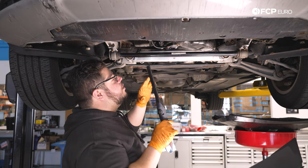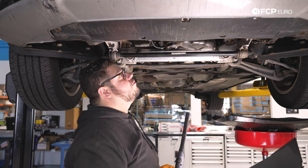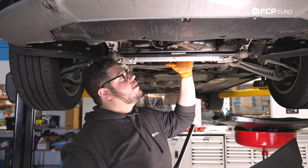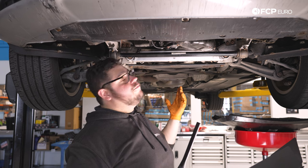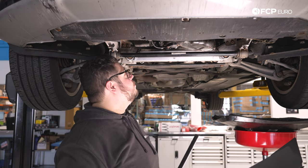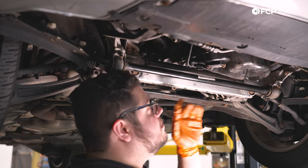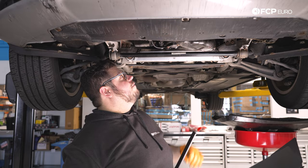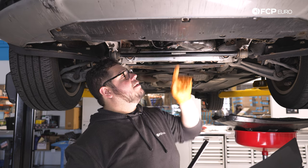We're going to avoid removing any of these items just because we're equipped with a mechanical rack and we're able to squeeze in our tools without removing them. Another tip: if you're lacking the space to work and maybe keeping the rack in place, you can also lift the engine from up top using the anchor point — we'll show you how that looks. We still have the oil level sensor in place merely to avoid drippage while we're removing the T30s. Without further ado, we're going to tackle the pain-in-the-butt T30s in the back first, and then reward ourselves with the easy-to-reach ones and the oil level sensor.